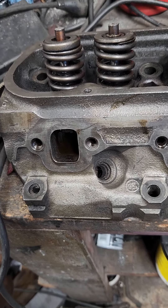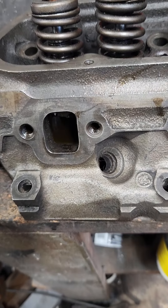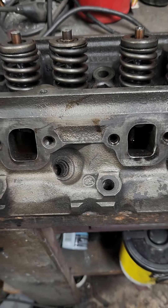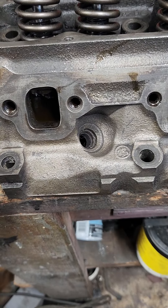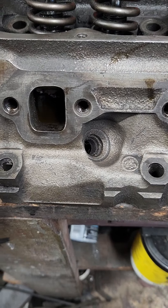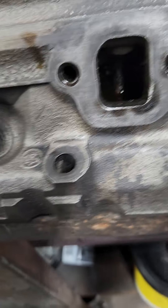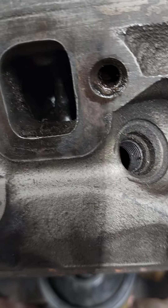Hello, hope you're all doing well. Here's another trick of the trade. I showed how to clean a port out using any kind of petroleum-based product you like, and another trick of the trade is this: you fill the port up with any kind of petroleum-based product you want, and you leave it set overnight. What you're going to see is if it holds the fluid — like that one did, that port did, this port did.